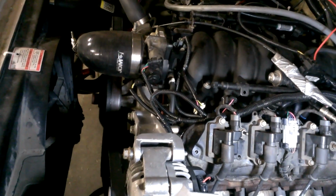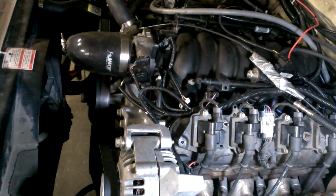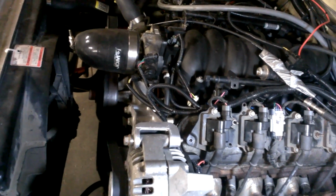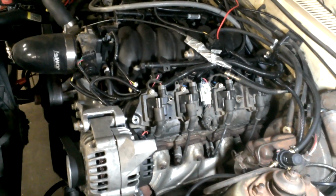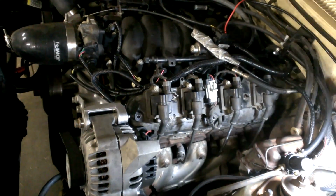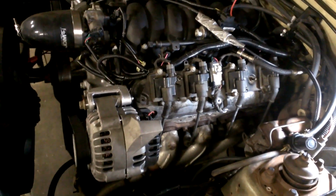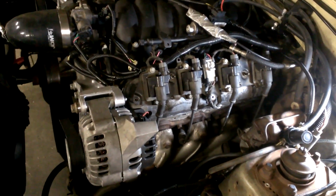I got this compressor regulator here that I had laying around because I threw the extra spring in the wastegate down there. I was nervous, because when it was making 5 psi with that reference connected right there, going down to the wastegate, I knew the spring would not be that strong. So all I did was unplug that reference, straight up unplugged it and plugged the port. It went to about 10 pounds with no reference at all.